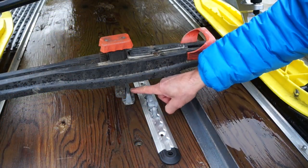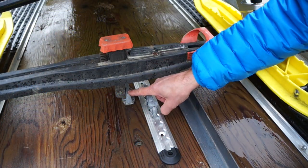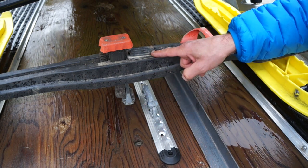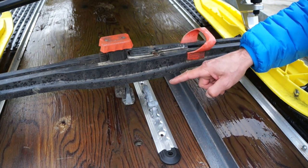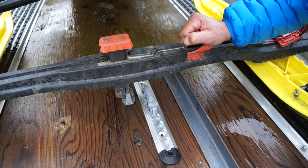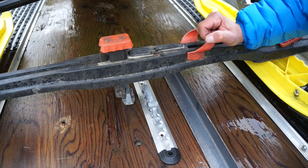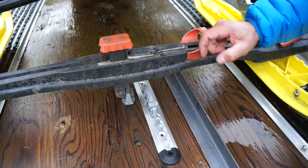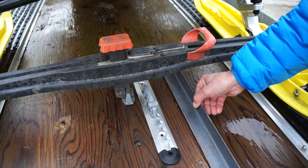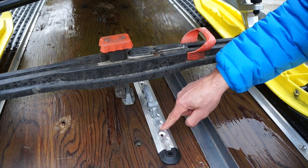As you can see in the front, the super clamp is locked down with a regular deck hook — but that deck hook can be replaced with Supertrack, making the front super clamp adjustable as well. This works extremely well in enclosed trailers where we're working with different configurations. When mounting it in the front, it's important to go to a frame rail, or use angle iron as a backing plate the same way I did in the back, so that it doesn't pull through.